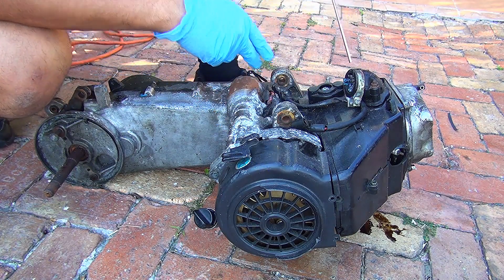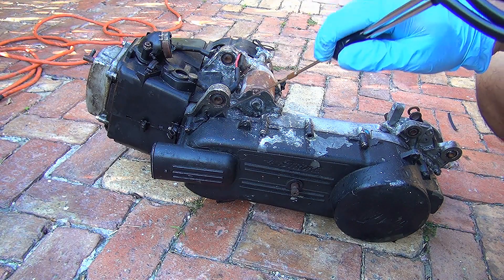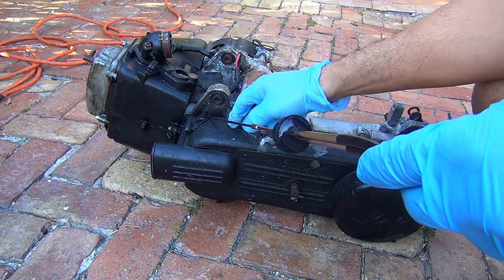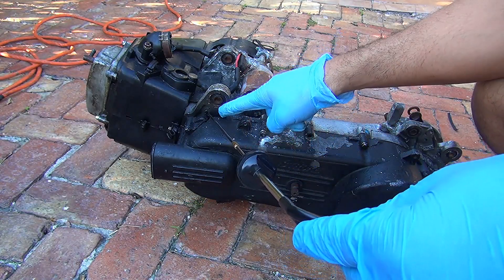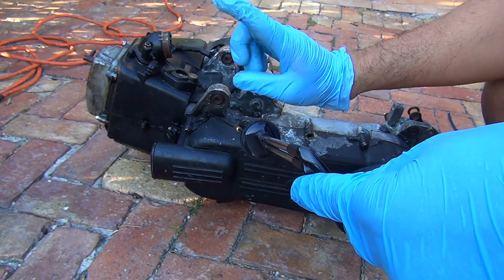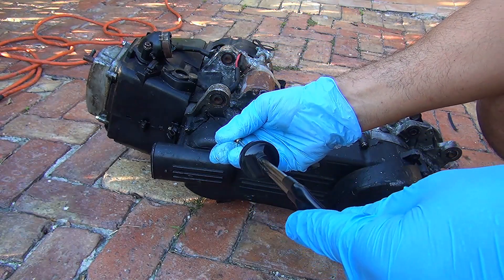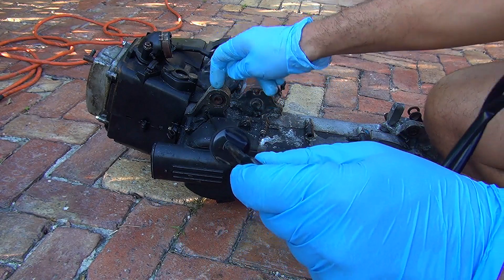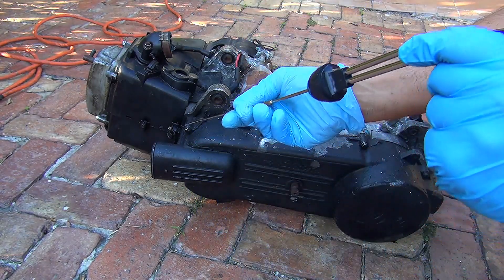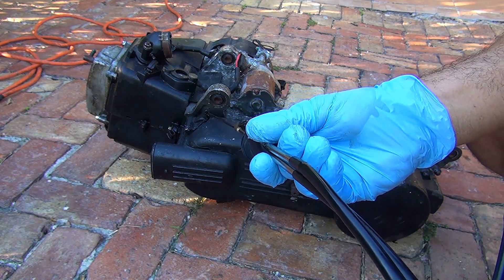Now we go to the other side of the motor — the left side. By pointing the stethoscope right here on this part you can listen to the motor and how it is moving. If the piston is wobbling you are going to hear that — it could be the piston ring causing the wobble. This location also lets you hear the crankshaft inside the motor; sometimes the crankshaft bearing could be broken. By pointing on this location with the stethoscope you can listen to your motor.